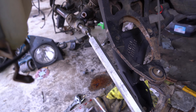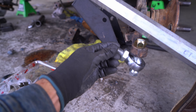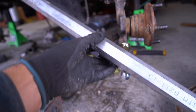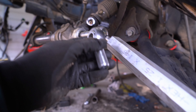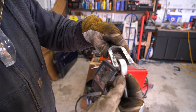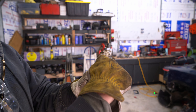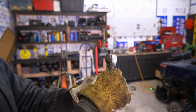Trying to figure out the steering, which has always been an issue even with V1. We've got the heim joint down here, but the ball joint at the rack does not provide enough articulation for our tie rod to meet the knuckle. So the obvious answer is to heim the other side as well, which means we have to build our own clevis to hold the heim joint. You slip the heim joint in like that so it can fully articulate up and down. We can't use a tuning fork — we have to use the existing tie rod end. So we're going to cut it right there, weld on a little U-shaped clevis, and then we should be able to bolt this right back in.